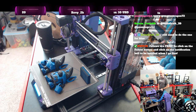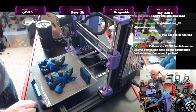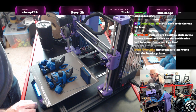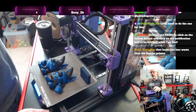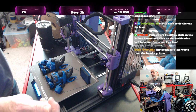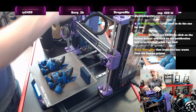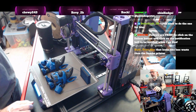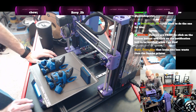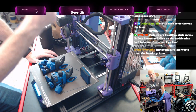When I first started, I was having a lot of problems. I went and watched some videos by Chris Riley on YouTube. There is a secret menu you can get into on the MMU when you first start it up — the printer has to be off. You press and hold the middle button on the MMU unit, then turn the printer on. As it goes through its initial cycle, it will go into the special menu where the first and fifth lane lights light up.